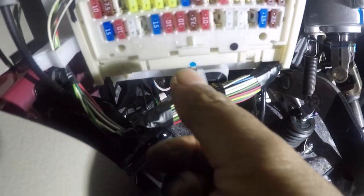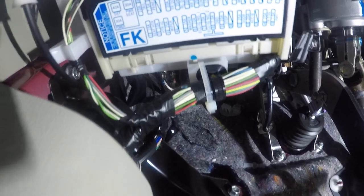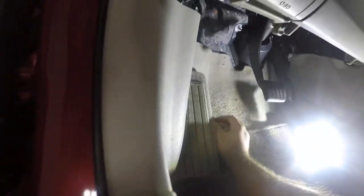These are miniature fuses — you can just grab them with needle nose pliers, pull them out, and put them right back. It doesn't matter which direction you put it in. Make sure you close this back up and it clicks — just like that. That's how simple it is to change your fuse on this. If your cigarette lighter doesn't work, change that fuse. Thank you for watching, don't forget to subscribe, share, and like.